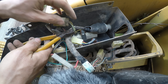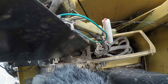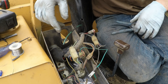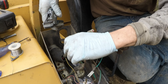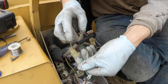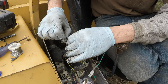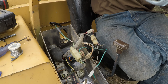I cut the wire and now with the ignition on, there's no temperature light. I ran a new wire from the engine — the same color as what was there — and put it in this loom to hopefully prevent another rub-through or whatever happened to the original one. I looked for the problem with the original wire and didn't see anything, but it's easier just to change the whole wire rather than spend a ton of time trying to find the fault.